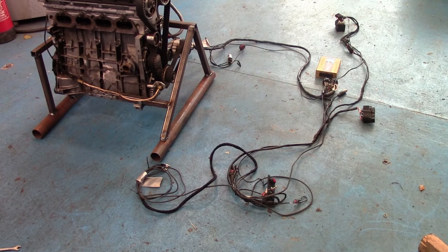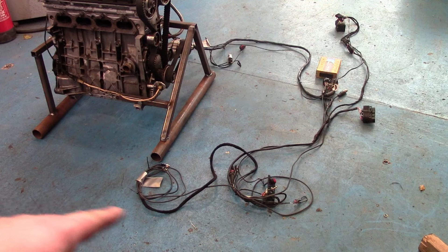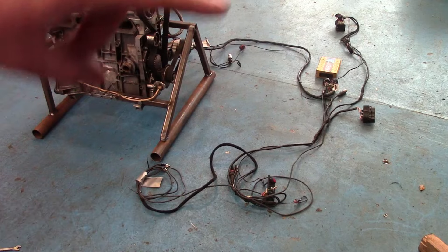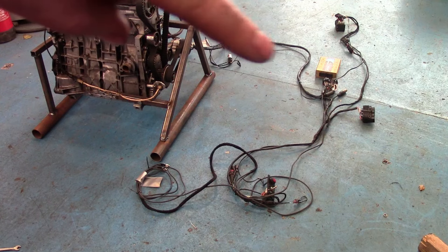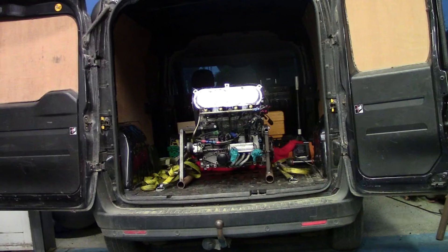This is the whole wiring loom for the car out now — I'm going to send that over with the engine. There's not really much to it: one bit is just for the cameras and the dash, that's the ignition beside the steering wheel, then you have the ECU and a few relays down beside your seat, and this bit here is the kill switch in the engine bay where you connect the battery. The end bit just plugs into the engine harness. I'm heading off to the UK tomorrow with this on the boat, so I think I'll put the car back together again without the engine, because I'll probably have no engine for a while.